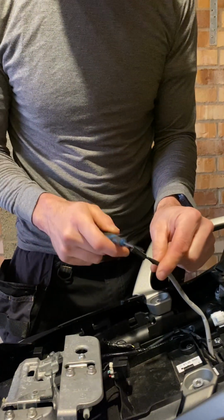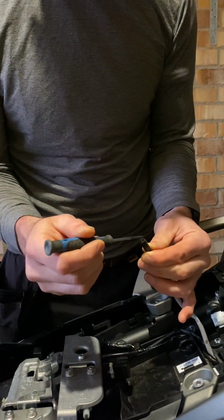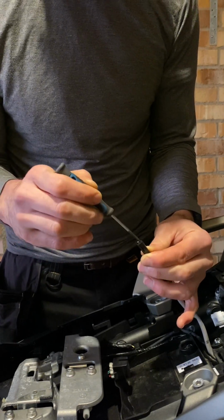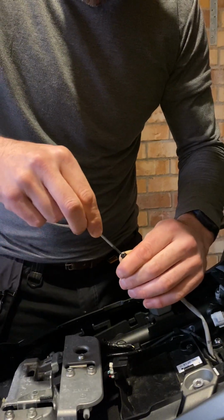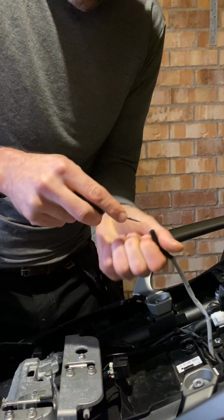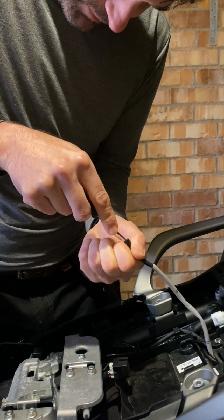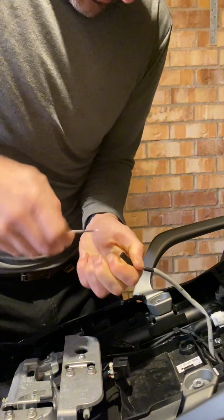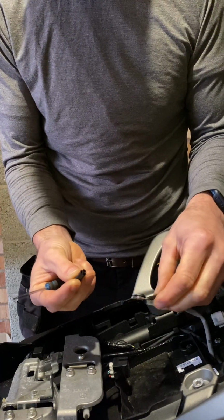Now what I do is I actually take this off. In order to get these off, quite simple, you look inside here, you can see the two connectors, and basically what we do is just get a very small screwdriver and you push the pins. It seems quite tough to do, but it does actually work. We can just push the pins back through this little plastic connector block. Okay, so look, the two pins come out dead easy.